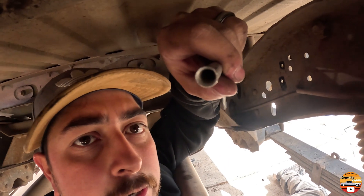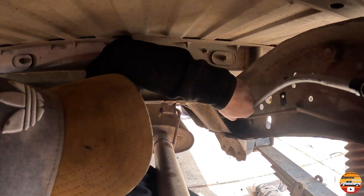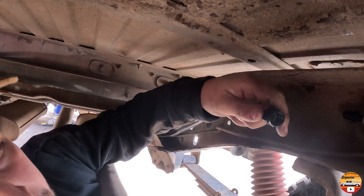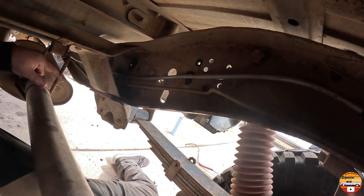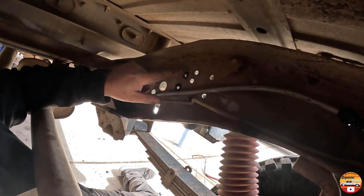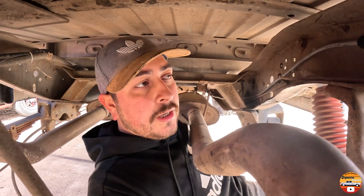When I take this off, we should have a nice solid 37-degree flare on this thing. You can see our flare, and see how well that tubing sleeve slips into that. Our nut slides up and over that, and we have this beautiful little AN flare. That'll go right onto our fuel filter, and we'll hand-form this fuel line to fit across the rail, nice and smooth. I went ahead and removed all the old fuel lines, so we have all these nice mounting holes and brackets that the original fuel line was on. We can tie it to the brake line, do whatever we need to make it stable, and then just run it up to the front of the truck. Definitely consider using hard line for your next project - super cheap, super affordable, and definitely durable. This line will probably last the life of the truck. It's not going to corrode or rust.